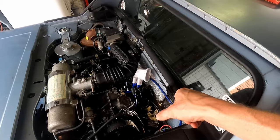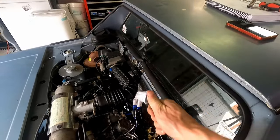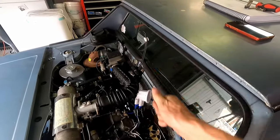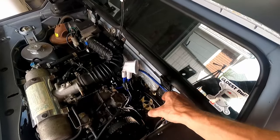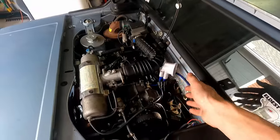So if we're trying to fire the spark plugs before it reaches top dead center, as it comes into compression, it will fire and push back down as efficiently as possible to give us the most amount of power. So it's really important that we come before, but if we go too far, we're pre-detonating and you'll hear some pinging, and that's not good.